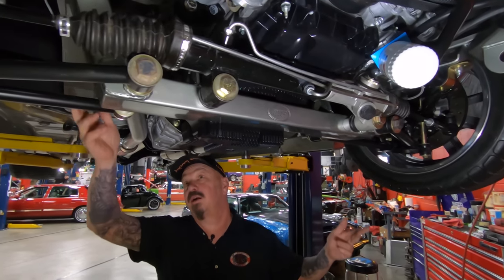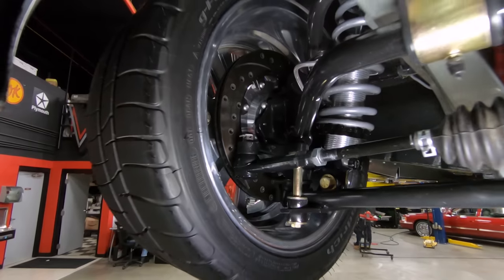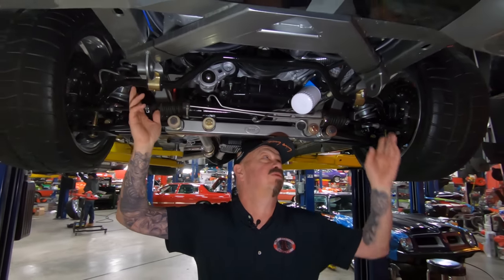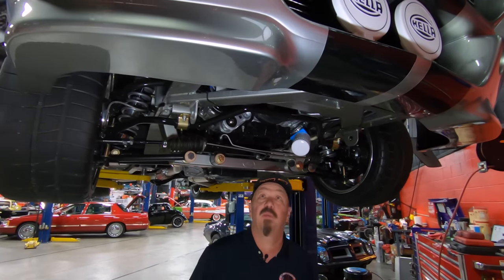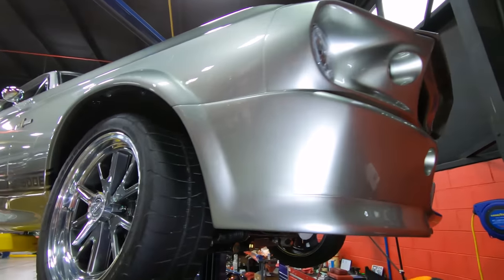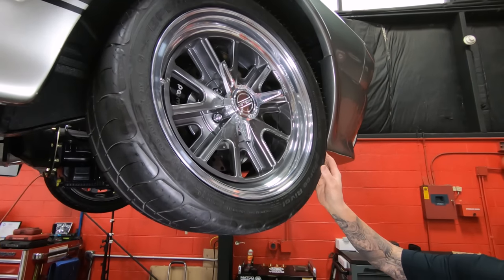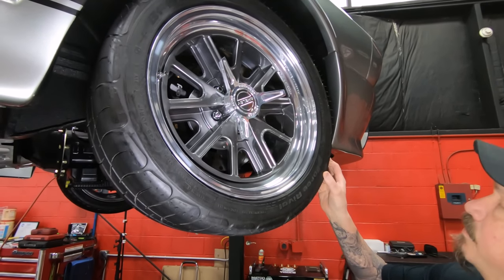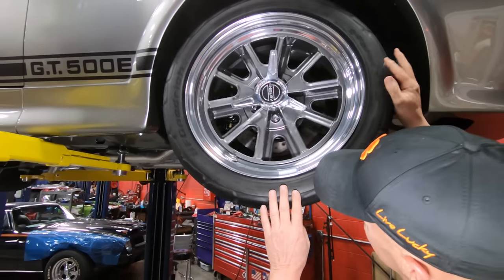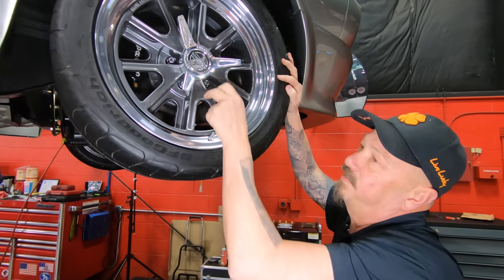Tubular lower and upper control arms, coilover holding it up. Disc brakes up front and in the back. Look at that oil filter right there where you can get at it nice and easy. They take those radius arm braces off and put a really cool brace system in there. Not a mark on the nose anywhere. Up in the wheel well, it's all nice and clean — we've got the GT40 style American Racing wheels. These spinners have got a set screw in them — make sure you loosen that set screw before you take those off, then take the five lug nuts off.